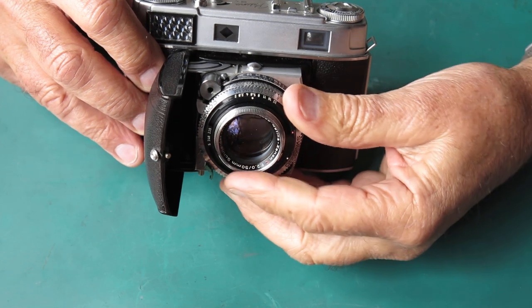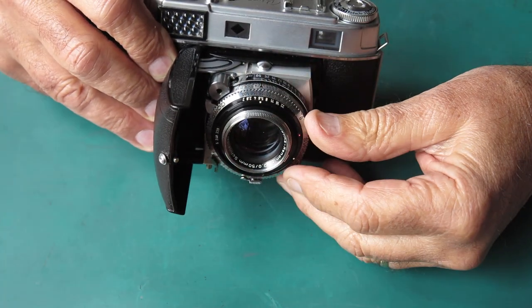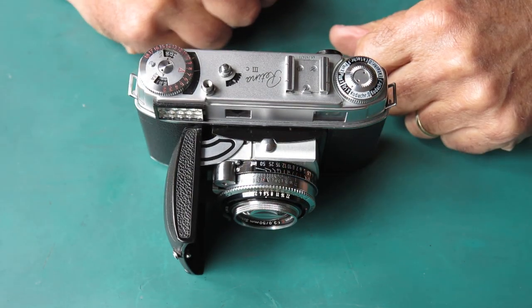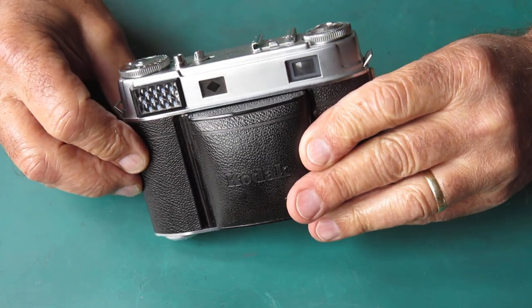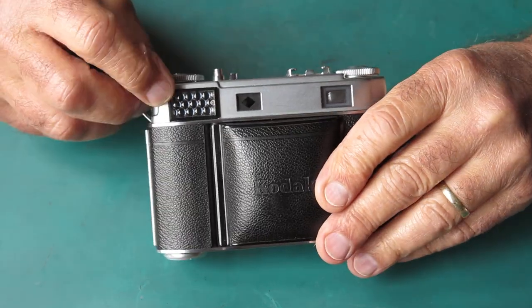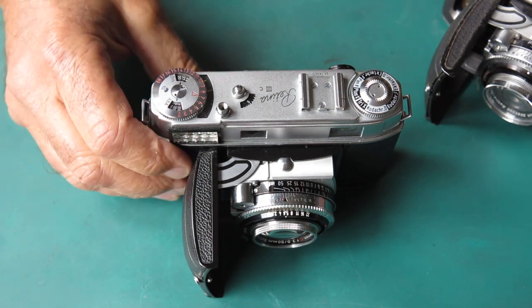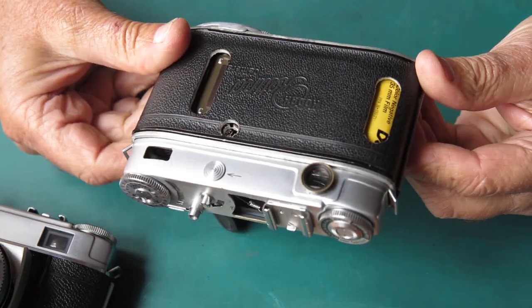First I'm checking to make sure the shutter is not just loose in the body of the camera, because if it's shifted it would affect the timing since the shutter release acts on the shutter at this point. We need to get into the top of the camera. This camera is a Retina 3c small - it's the second or last type of the Retina 3c, and has a single rangefinder. Opening this up requires a bit more thought than opening up an earlier 3c.